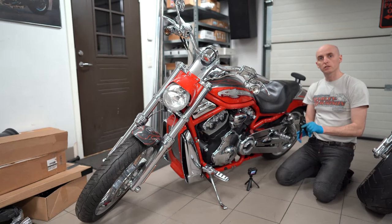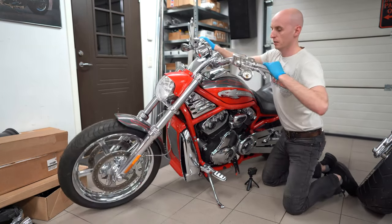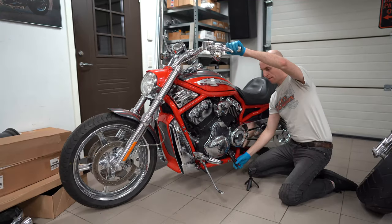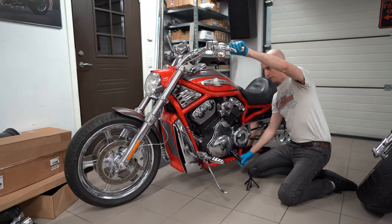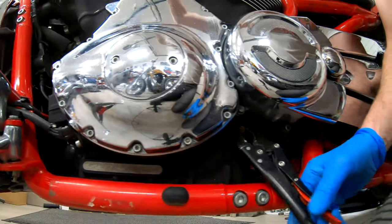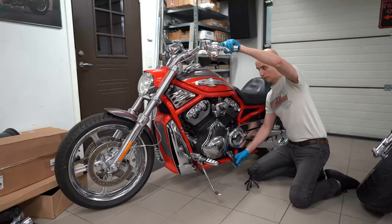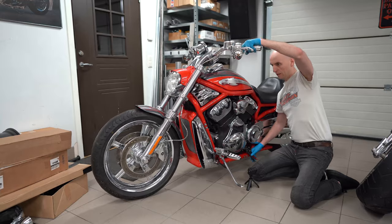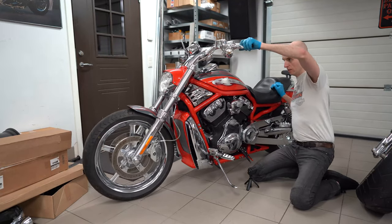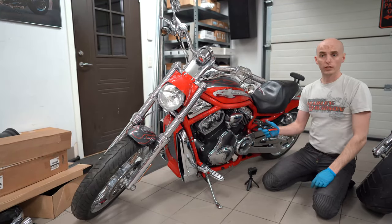The first thing I'm going to do is grab the broken shaft with locking pliers. The second step is that I lift the bike up from the ground. As the gear is in, I'm pushing it slightly back and forth while at the same time turning the shaft. As you can see, it's on neutral now. The bike is moving freely and it's easy to operate. All you need is locking pliers — that's it.